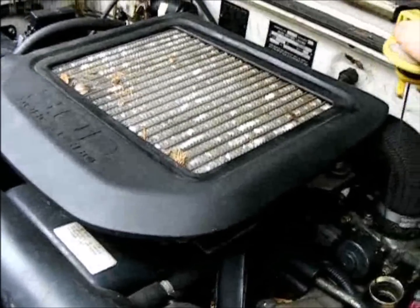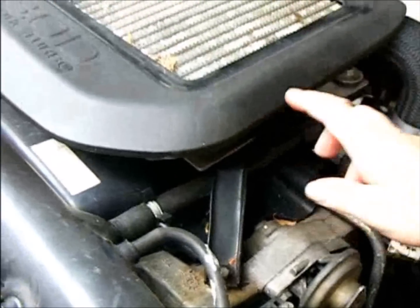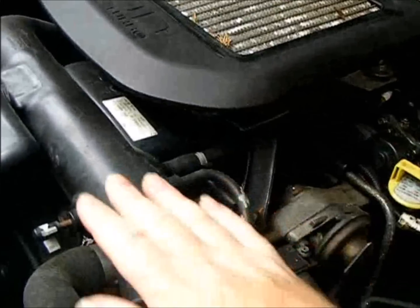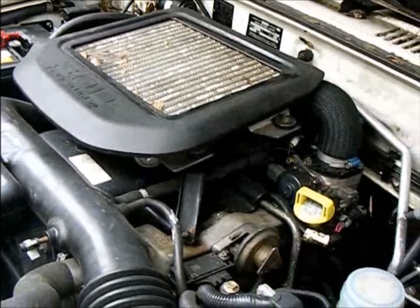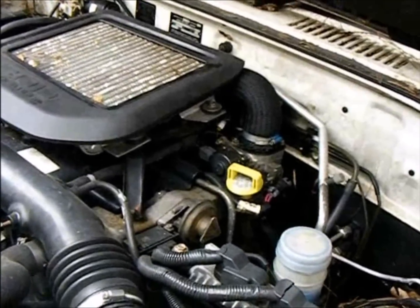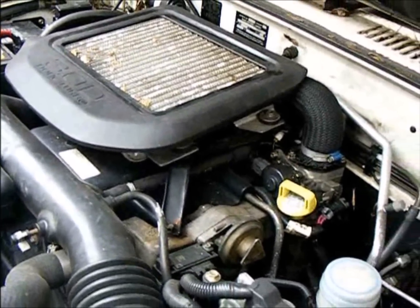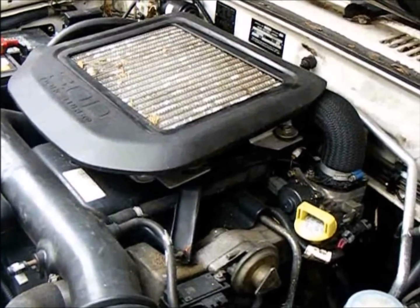And that's not a very happy situation, but of course what it means is that the seals in the head, you saw the white smoke going out the exhaust, which is clearing now, it's gone off down the street. They've gone, and what's happened is that the cooling water is passing by those seals, and it's going into the cylinders, and it's coming up as white smoke in the exhaust, and the engine's rough. It won't do more than about 2,500 RPM, 3,000. The thing is very low in power when you go along the street, although it's still got a lot of torque in it. After a while, it starts to behave even weirder, as the fault gets worse and it leaks more, or it stops, or whatever. It's the nature of all leaks, an intermittent leak.